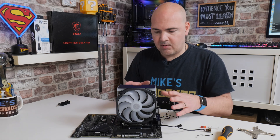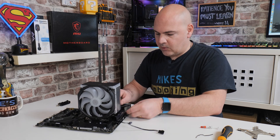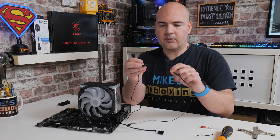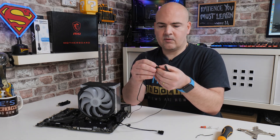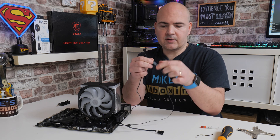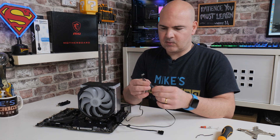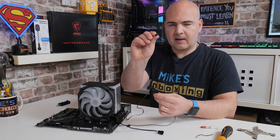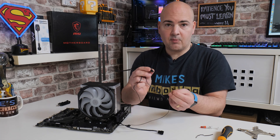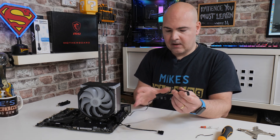That is effectively the CPU cooler part done. Now we need to work out where to attach our cables. You can connect up your addressable RGB — there is a pass-through on the ARGB. Disconnect one of these and connect in your 3-pin 5-volt addressable RGB header, taking care to match up the arrows so the polarity is correct. With the 3-pin ones now it's difficult to do it wrong — with the 4-pin ones it was horrible. You have a little cap there, so put that to one side in case you ever need to blank it off later. Make sure the fly lead that's coming off is covered, as there is a possibility of shorting out the 5-volt on the motherboard if it touches any metal.